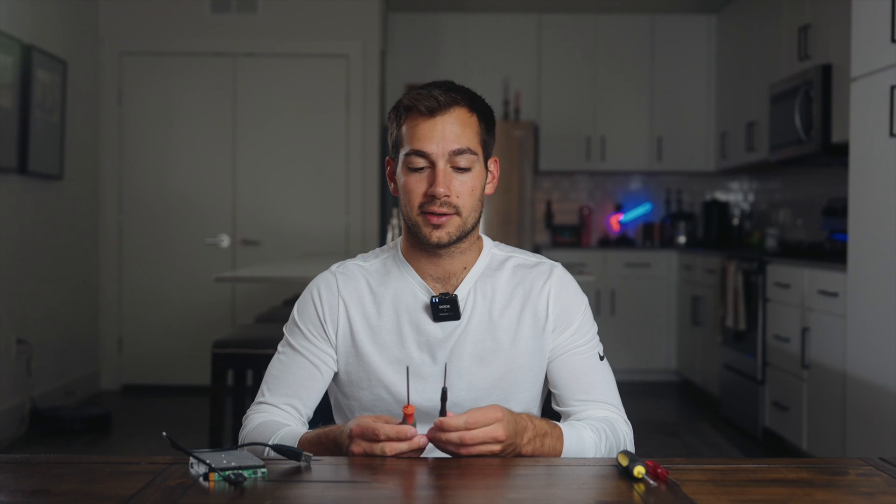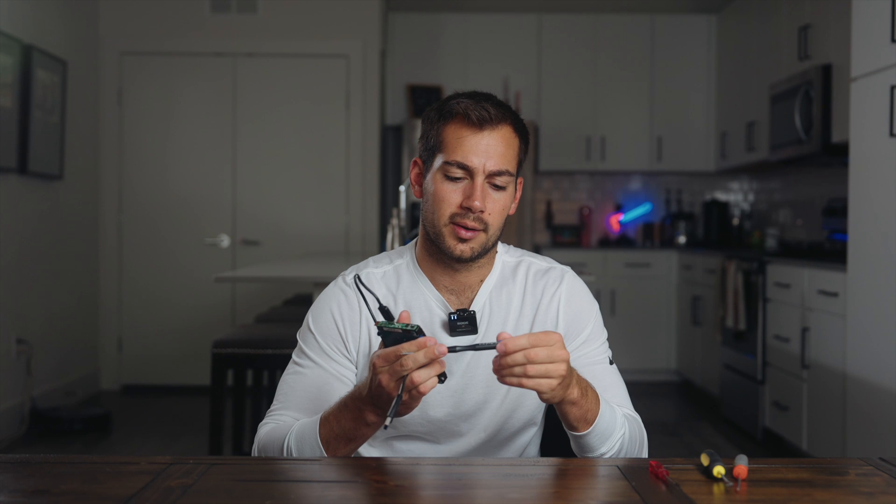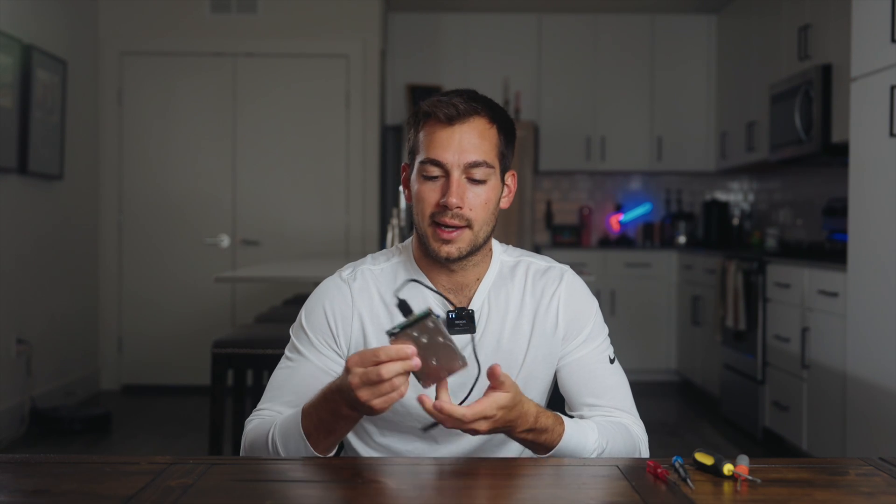So in front of me on my little desk I have a couple of tools. This hard drive is a Seagate 4TB external hard drive. The principles are going to be the same whether it's an external hard drive or the actual hard drive in your computer. The weird thing about this one is I ended up having to use several different types of screwdrivers to get the case open. I believe this is a T8 — this is a Torx bit. I also had to use these five-point star bits; this is called a Pentalobe 1.5. You'll need to figure out what type of screwdriver you need to open yours up — in most cases it's going to be a T8 Torx bit, but you can find that info from your hard drive's manufacturer. I also have this little curved hook tool to help move around parts without putting your fingers on stuff.